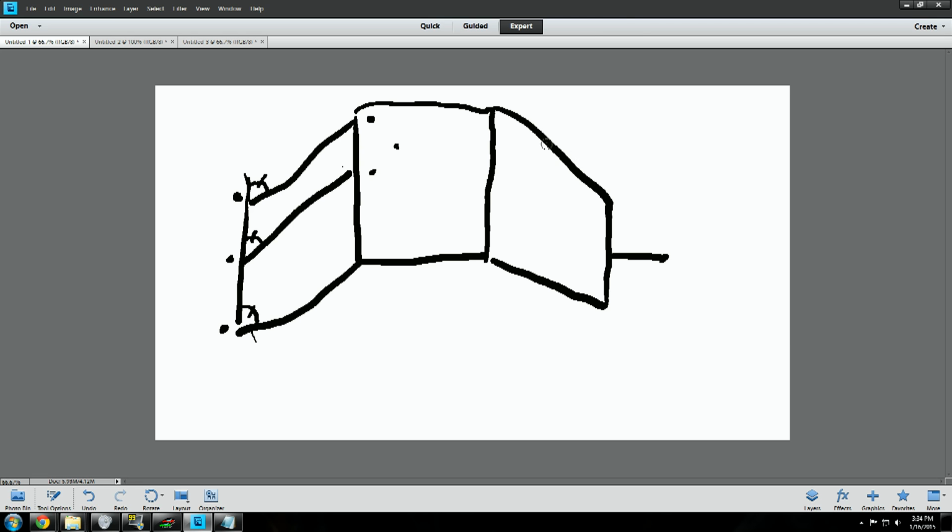Now once it gets up to the top, once you compress it, like say you go around a corner or something like that, what's going to happen is that front, so I'll just draw it extended further out. Okay, so imagine this top A-arm is the same length as this one. That top A-arm is going to be like this, and then this lower one right here is going to cause this. Now this is again extremely exaggerated. It is going to cause this to essentially angle in.